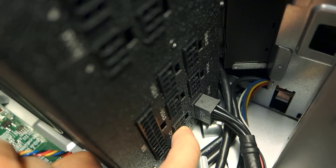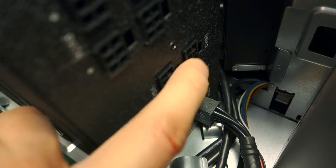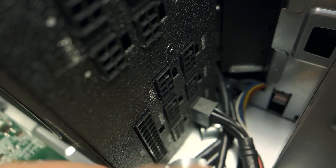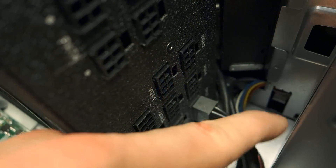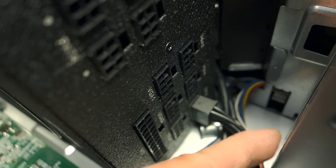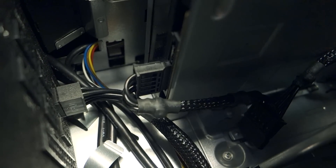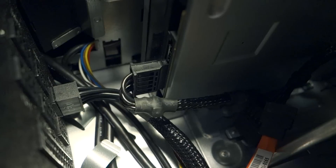There are a total of four VGA power ports here, allowing for four-way SLI. I need to be careful because the optical drive is right here and I don't want two wires obstructing it, so I'll use the two upper VGA ports. For the optical drive power, I elected to use the last connector in the chain and routed the remainder of the cable through the hole that normally houses a second optical drive, creating more space for airflow.